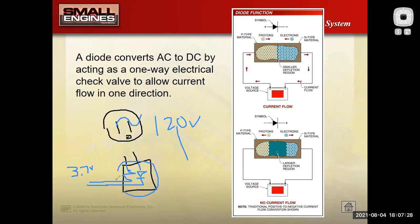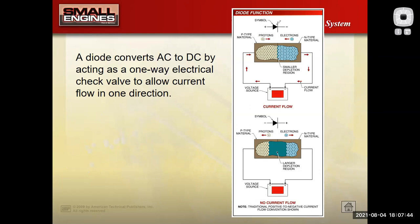That's everything that this little box does, okay? It's a rectifier, and it's also a step-down transformer, if you will, to make it a lower power level, lower voltage level for my cell phone. All right, and part of what makes that thing work is diodes in it. So we use diodes quite a bit when we're rectifying AC into DC.